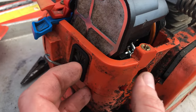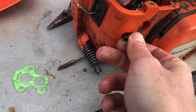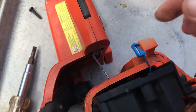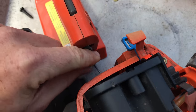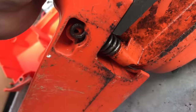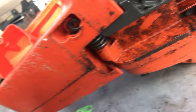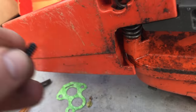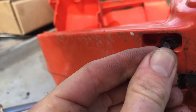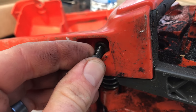I'm reinstalling that back plastic piece, which turned out to be the only piece that was necessary to take off besides the handle. Then I reconnected the throttle cable back into the switch using needle nose pliers, and reattached the chainsaw handle with its screws and springs.